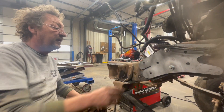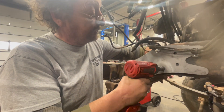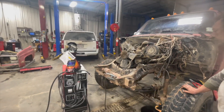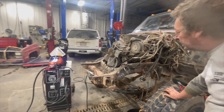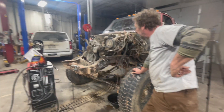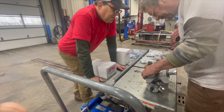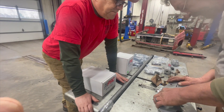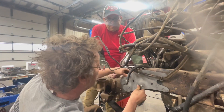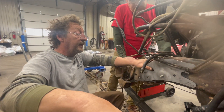The part I'm worried about is they're off a little bit. Let's match the plate up with the steering box and make sure it lines up. See, look at that — that's almost how much it's off on the frame. The plate's off a little bit because of how the plate sits up there. So we'll need to elongate the holes just a little bit. I'm going to bolt it back on, heat it up with a torch, and pound it in right here, and that might suck it back in line.